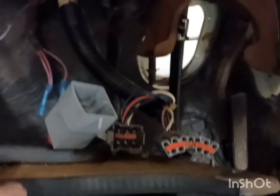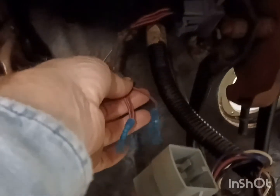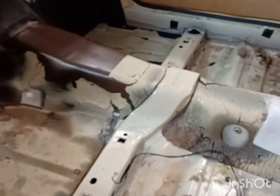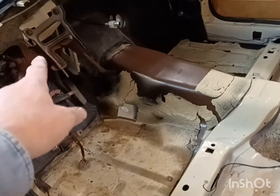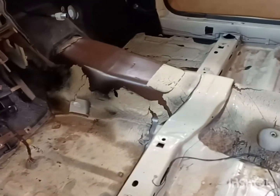Got the brake pedal in, all painted up. This car was an automatic so I went ahead and pigtailed my neutral safety switch — you've got to put your clutch in to start the car. I pulled the carpet out because I've got to drill a hole; the clutch cable hole in this car wasn't as big as the GT's. The hole needs to be one inch and three-eighths. Plus I've got to cut the hole for the shifter and I don't want to mess up the interior — it's in really good shape.